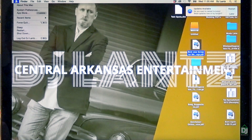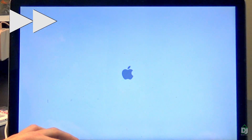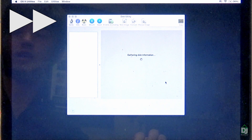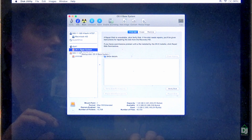What we need to do next is reboot your computer into Recovery Mode, as macOS calls it. When you hear the chime — although new Macs don't have the chime, but you wouldn't be switching to an SSD on a new Mac — hold down Command R. You'll see the progression bar; hold down Command R as you see that. Once you're into Recovery Mode, hit Disk Utility and Continue. You can see your internal hard drive, the external SSD, and the base system you're running on in Recovery Mode.